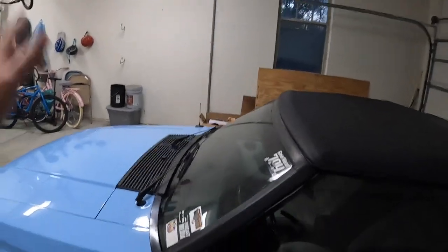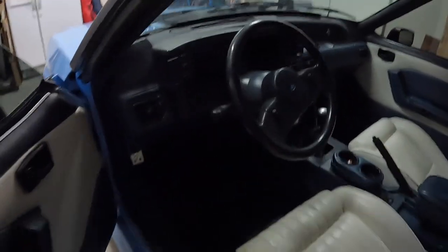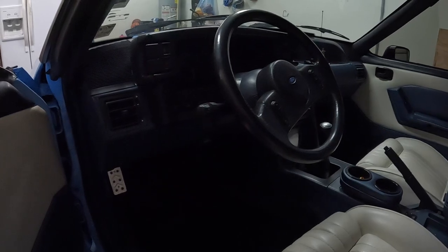What the issue is — I want to fill you guys in. It ended up being how the dash was wired. Matt and I had rewired it and because it was having issues, it was shorting out. The way that we did the rewiring was not good — I was blowing that five amp fuse you saw. That was because there was too much power going through it; the way we rewired the dash was incorrect. Matt came over and helped me wire it correctly — it was just a simple mistake. I was actually the one doing the wiring, so I probably didn't listen to his instruction. That took care of it — since then, no issues. So really I did not need to replace the ignition switch, but since I did just show you guys — everything is put back together. That was the issue.